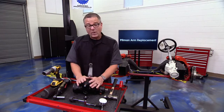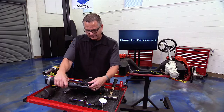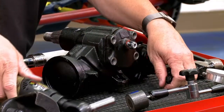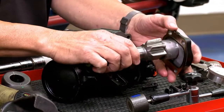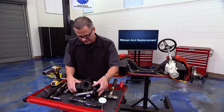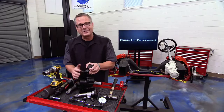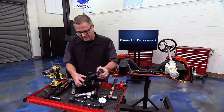What's going on inside when we damage it? If I pull this cover off you can actually take a look inside this gearbox. Don't take your gearbox apart — there are clearances in there, sector shaft lash to worm gear clearance. This is the sector shaft, and it has super tight clearances where it makes its adjustment with the worm gear. Inside there are needle bearings. If you're prying on it or hitting on it and it's shifting left or right, you're going to damage those needle bearings every single time, and then you'll have a problem with your steering system.